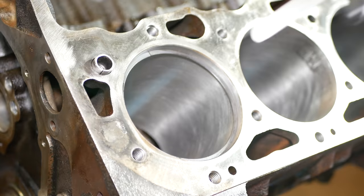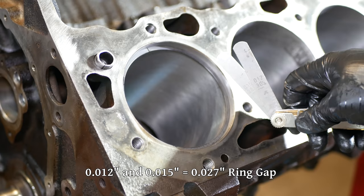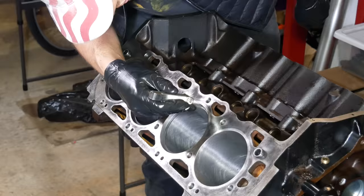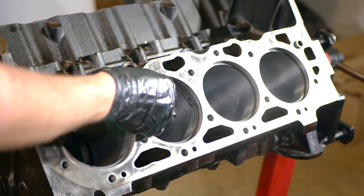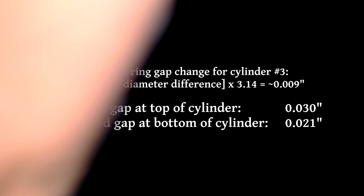In hindsight I really should have measured towards the bottom, especially in the cylinders with a lot of taper, just to make sure the gaps weren't getting too small. This engine won't be seeing a lot of boost and it'll stay relatively low RPM, so I don't think it's going to be a problem. Based on some info and charts I was able to find online, the compression rings in this engine should have at least 0.025 inches of gap. As it worked out at the top of each cylinder, all of the rings measured out between 0.025 and 0.030 inches. Normally you wouldn't expect to see that much variance, but I double-checked by switching some around and it isn't in the piston rings — that's just kind of how these cylinders came out. I think we'll be just fine with the rings as they are, and even at the bottoms of the smallest cylinders they should still have more than 0.020 inches of gap, which should be acceptable.